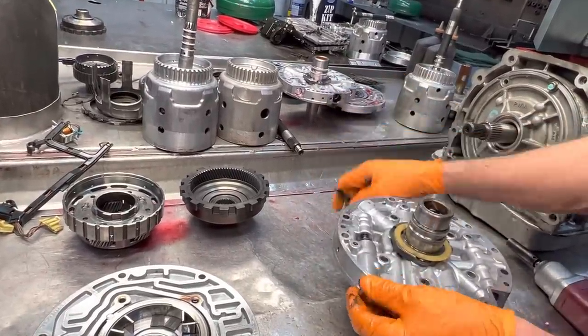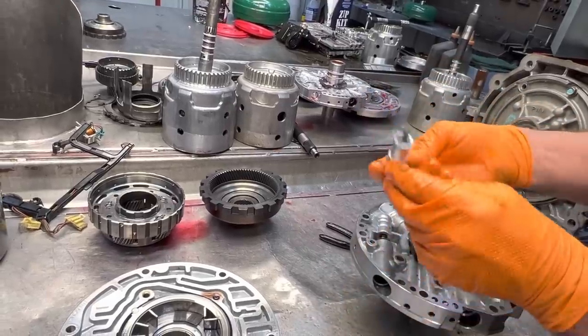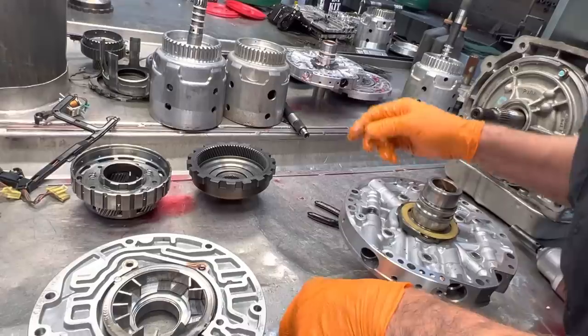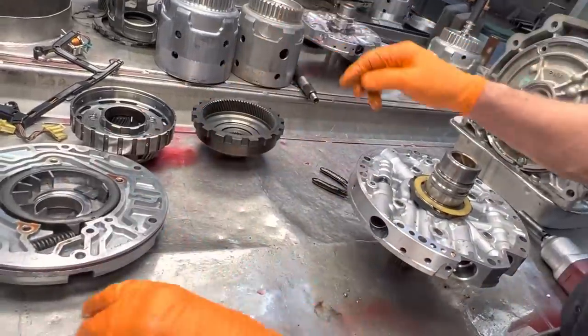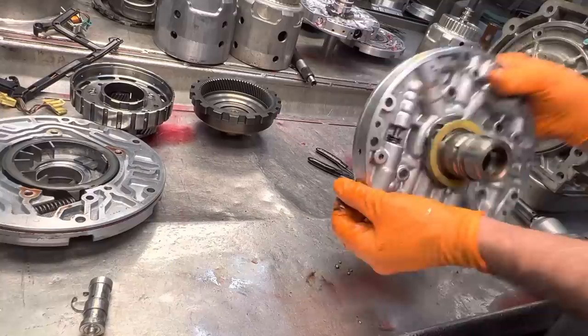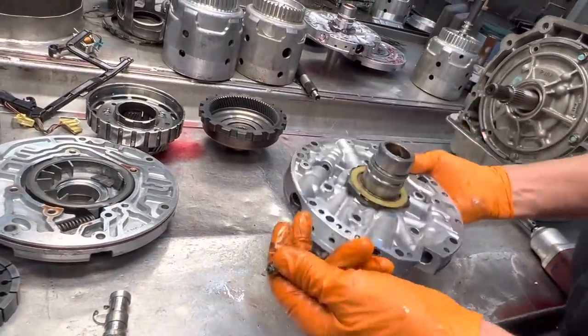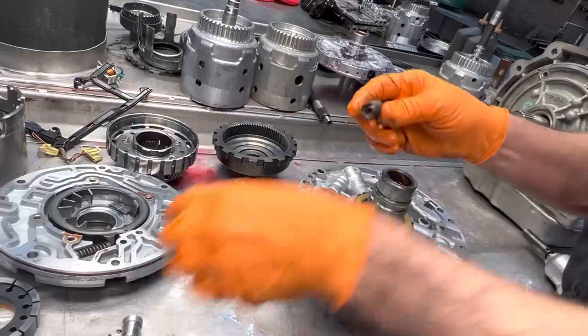This could be a one-ringer, two-ringer - so this is the bigger one than a single. Sometimes you can really put this boost valve in and put the shift kit spring in there, works really good. Anytime you put a boost valve in there, the first thing we do is pressure gauge right off the bat.